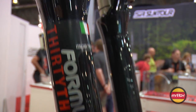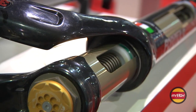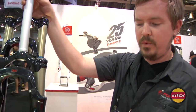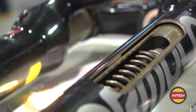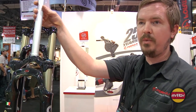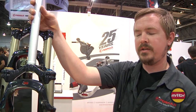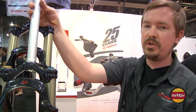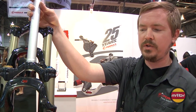It's air sprung, high volume, low pressure, and to go along with the air spring we have a dual coil which will eat the first 40 millimeters of travel. You can also see the polymer bushings. Along with the polymer bushings we use a lubricating oil made in Germany — it's Ballistol — which reduces friction so much that we do not really feel any stiction or friction in the fork while you ride, because the lubricating oil and the polymer bushings work so well together.